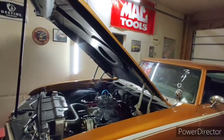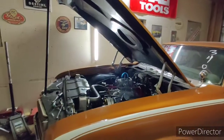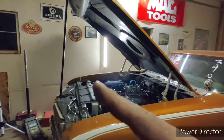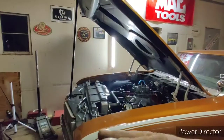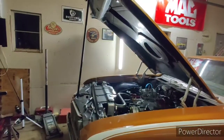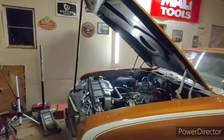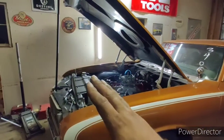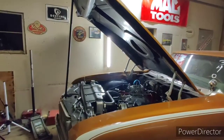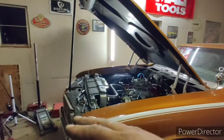I went to the blue pump cams, which I always thought were a little too aggressive — they're the same as the pink cam but with a lot more duration on the pump shot. My problem was if I romped on it from idle it would have a pretty bad bog. What told me it was lean was that if I pumped the gas a little bit first — dumped a little excessive fuel into the intake — and then romped on it, it was fine. That initial shot of fuel would aid the bog.